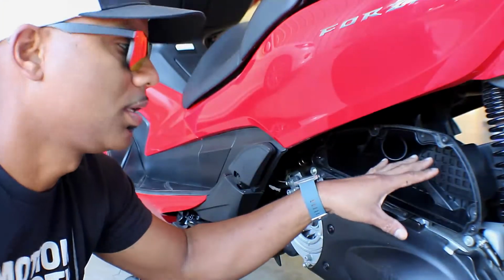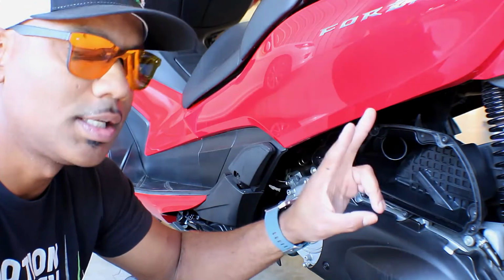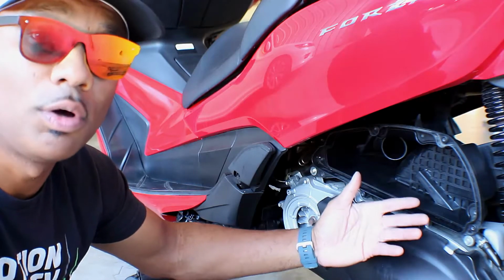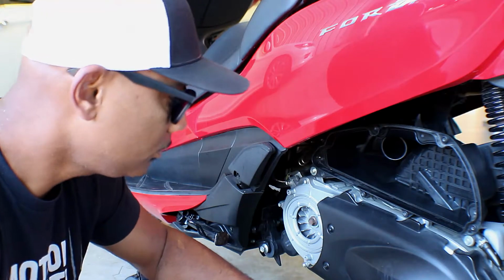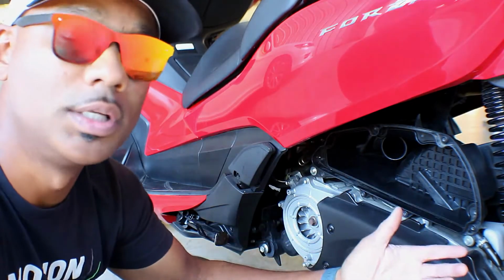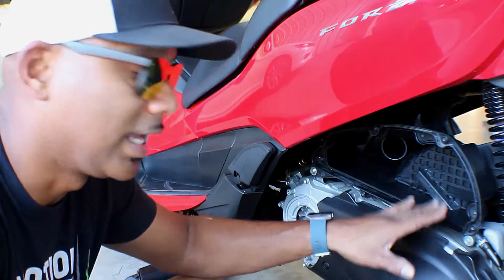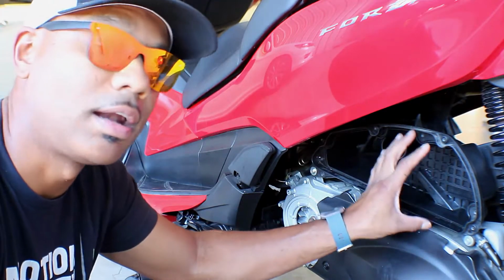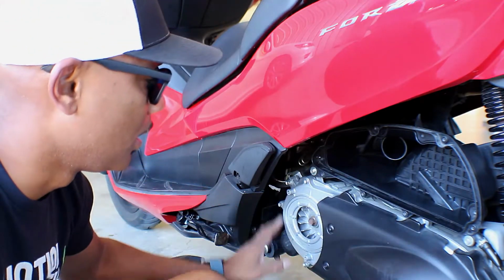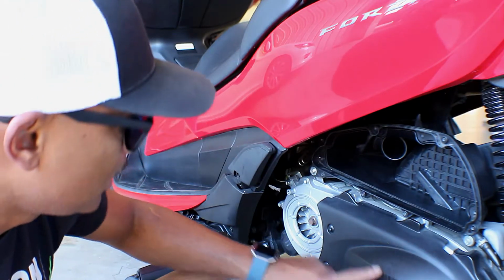If any of you guys are familiar with this, the airbox, I technically did not have to take this apart. The only reason I took it apart is because the first time it had this OEM stock air filter in it, and I took it off and it was full of oil. All the inside was full of oil. I don't know why. So I cleaned it all out and replaced it with this filter here. One day I just wanted to check on the filter, make sure it's clean, my basic maintenance. I took it off and it had oil in it again, not as much, but it had engine oil inside of here. So that's why I went ahead and took it out. Now you don't really have to take this completely off. Honestly, you don't have to take it off at all. It's only this cover and then 10 bolts around, but I want to take it off just to check it. Doesn't hurt. Preventive maintenance. So the next thing I need to do is remove this cover here.